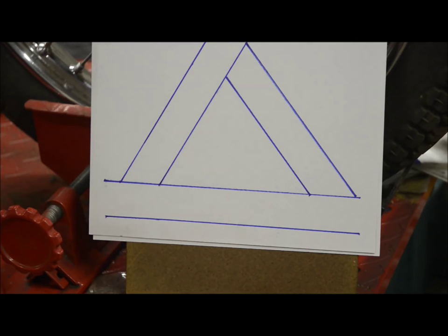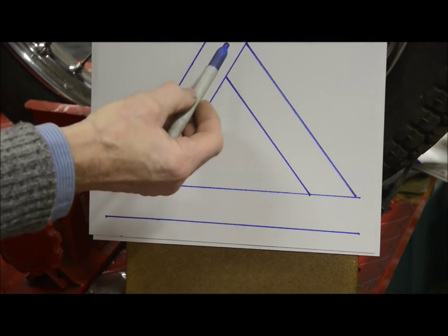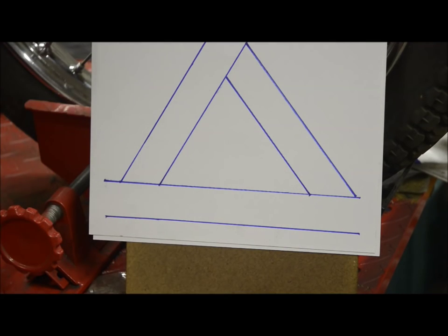Now, whether you're building a motorcycle frame or a Formula One car frame, from a strength point of view, you are always trying to triangulate the tubes. It spreads the forces. If you've got a force coming this way, it'll go up here, it'll go down there. Everything is much easier on the structure. You produce far less strictly one-dimensional forces.